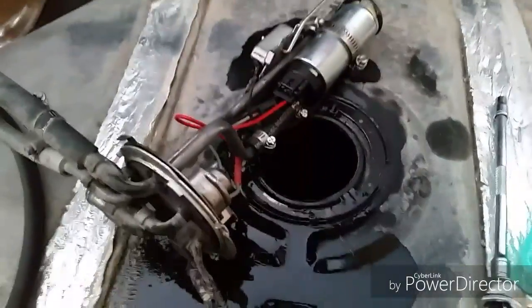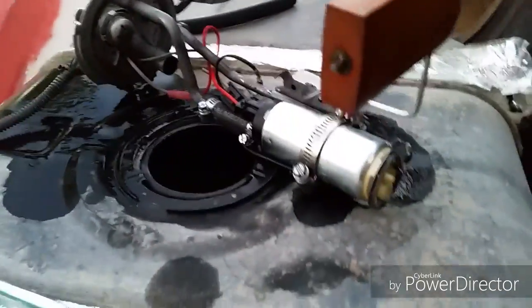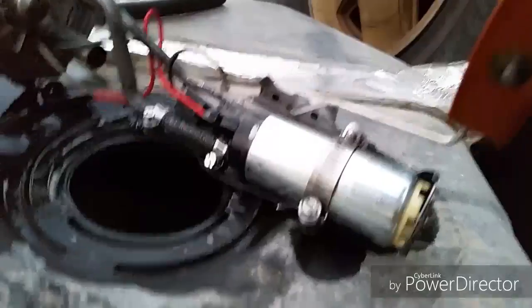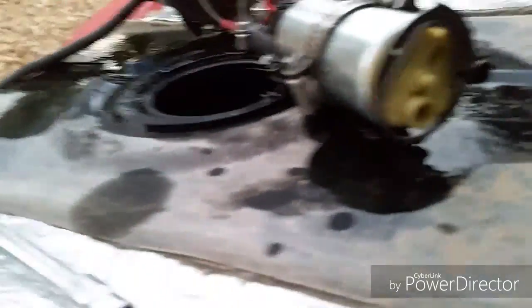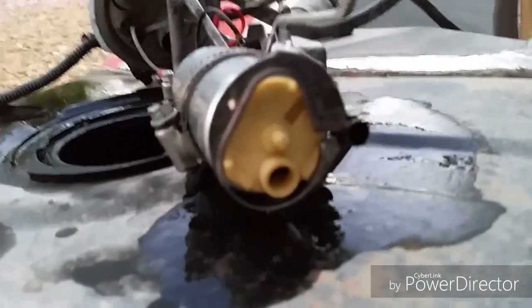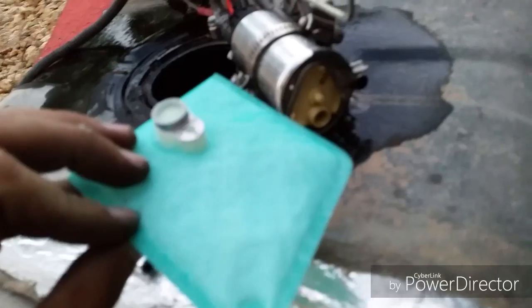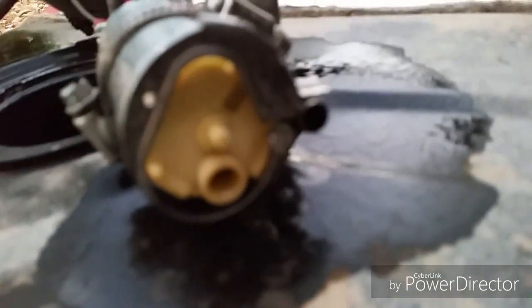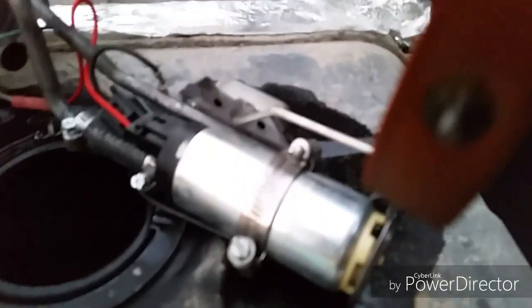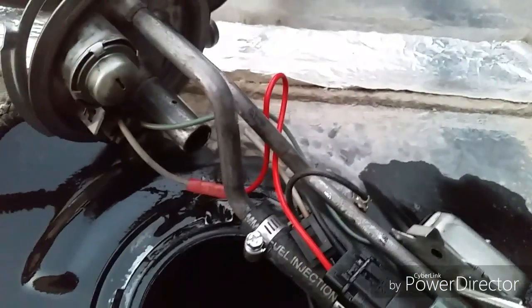Here's the Walbro pump installed in the stock S10 Blazer hanger. I used a hose clamp. This is a Walbro GSS — I believe it's a 342 — the Walbro 255 with that style pickup. I went to the parts store and bought a screen from Ford Ranger pickups; it's the biggest screen they had, and the green should mean it's alcohol rated. Hose clamped it into the sender to the return, and did a little wiring and spliced it in.